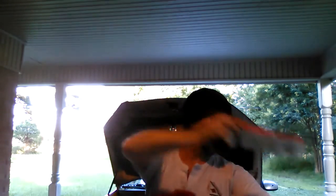The fluid turns yellow when exhaust gases are present, so we're hoping that it stays blue. We're hoping the car stays blue — and that the mosquitoes stop eating me. So let's go ahead and do this test and see if it'll stay blue. Cross our fingers.